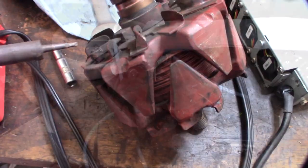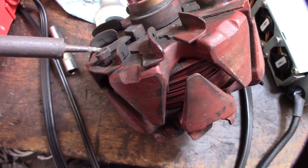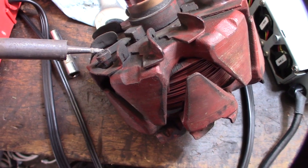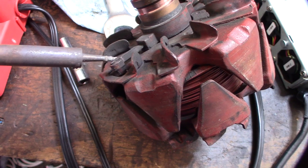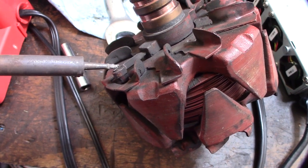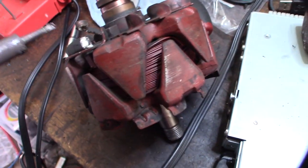Next part — I've got to work on the slip ring. I'm going to use my soldering iron and heat this up. This might or might not work just because the soldering iron is not big enough to heat this much — this whole thing acts like a conductor and it's going to suck away the heat. This might take a bit. Actually, it came up pretty easy. The trick was to put the iron down here at the bottom.